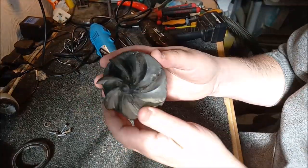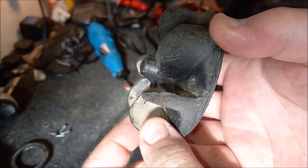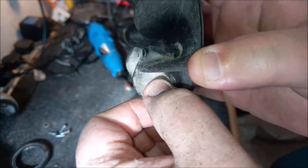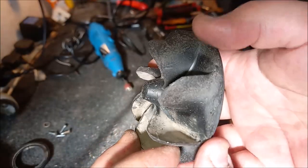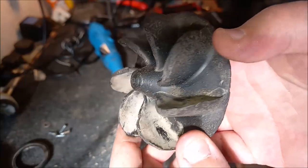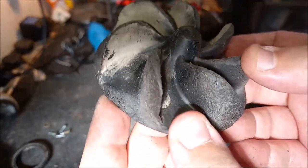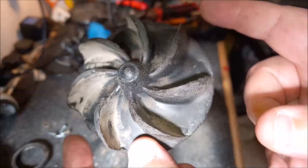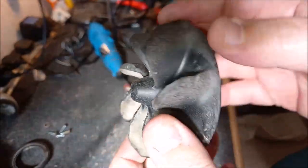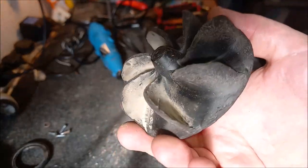Well, that's our attempt at it. If I hold it up to the camera you can now see that it is much smoother. The trailing edge of the vanes — that one's not particularly brilliant, of course that's the one I show you — but it is smoothed off, it's better than it was. This is just doing it by hand; if you wanted to balance it properly you'd use a machine. Where something had hit the fan I've taken out a little bit of the plastic on the opposite side just to balance it up. I think we'll pop it back in the machine and see what happens — we're not going to make it any worse, chances are it'll be better.